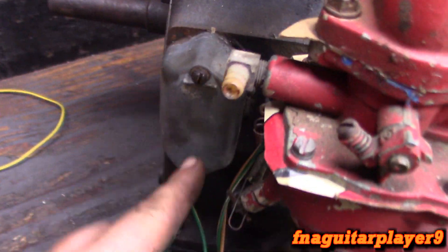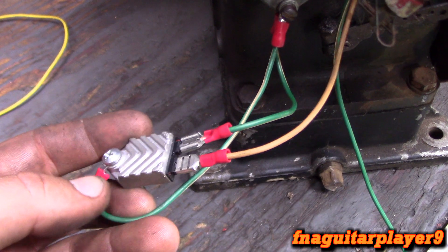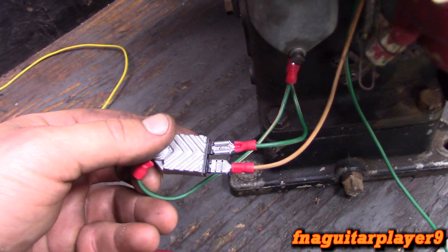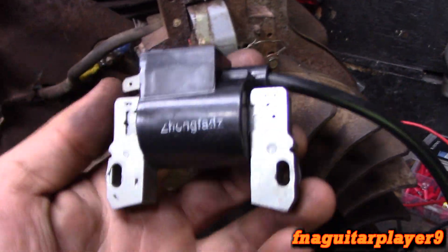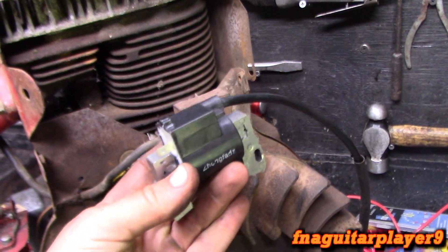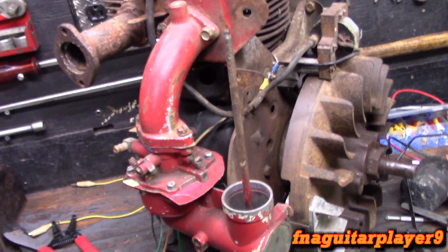I finally got spark. Had to mess with everything a little bit here to get it to work. All the points and everything were missing, so I just hooked up an electronic ignition module. This green wire will be my kill wire. I did try this coil just to see if it would fit — this is for like a 12-horse Briggs I believe — it fits right on there and it'll work. It's just got to be installed this way; put it on the normal way and it won't work. Now I'll go ahead and put the flywheel cover back on and see what it does.